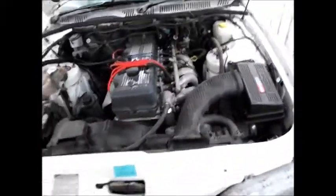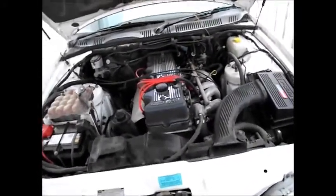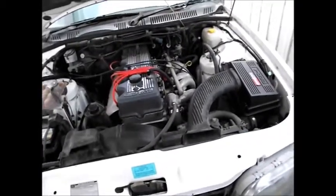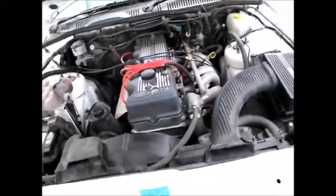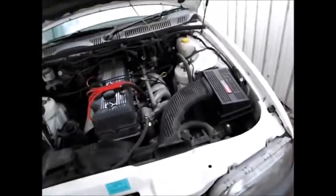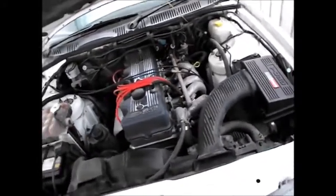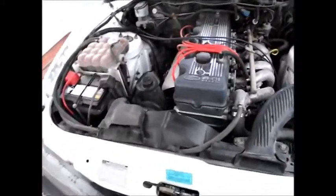So what does this mean? Well, basically, if you buy a car and you have no idea how old the coolant is, you should be changing it anyway. But this will give you a ballpark figure as to how much coolant there is. It may be that this cap, which has been replaced recently, and the old cap might have been a bit average — just basically overflowing coolant out of the overflow hose — and they might have been topping it up with tap water. Because once you add coolant, you shouldn't need to add water to it much. This allows for expansion, so you really shouldn't have to add anything to it.